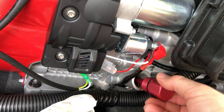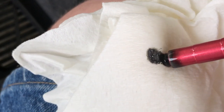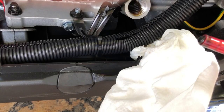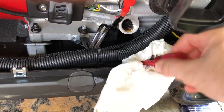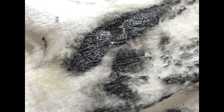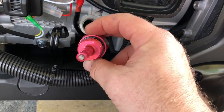These units don't have oil filters, and when they're breaking in they make metal shavings — lots of metal shavings. Both of my 9500 units did this, as well as my much smaller portable inverter generator. In this picture, I used a strong magnet for the first hour or so of operation and it looked like I was growing metal crystals inside the little fill tube. You can get a nice aluminum dipstick on Amazon with a magnetic tip that does a pretty good job collecting that metallic junk out of the oil. The problem is far worse in the first few hours, but even after 16 hours there's still quite a bit being picked up. Harbor Freight tells you to change the oil at 30 hours after break-in, so for 30 hours you'd have all that metal circulating over and over, causing premature wear in the engine. So please consider getting one of these dipsticks — I have no affiliation with them, I just found them on Amazon and find they work really great.